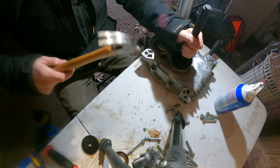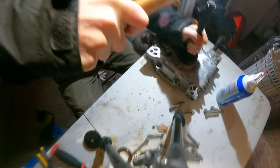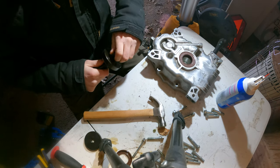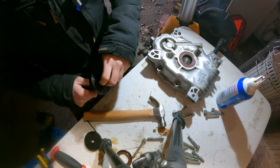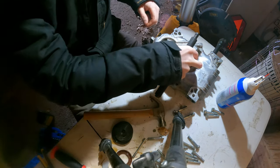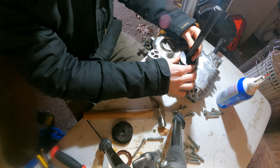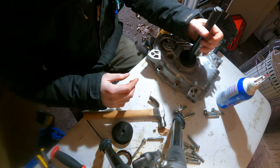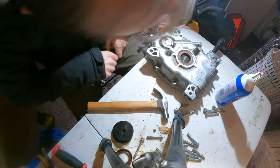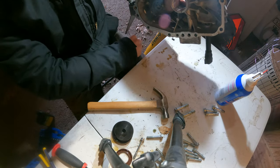Almost there. Did you hear the sound change? I'm flush all the way around. Now I need to switch to a smaller diameter seal driver to sink it just down below the surface, which is where the old one was. I'll try the 65 — actually I think that's too large, let's try the 63. I think if I center up, that's going to be about right. I want to make sure I'm nice and centered on that seal. That might have been a little too far, but I think it's going to be all right — I don't think it matters that it's down a bit too far.